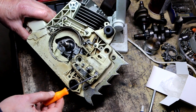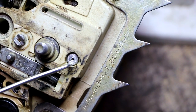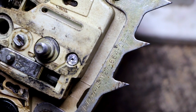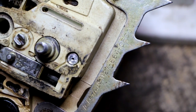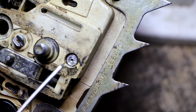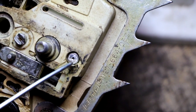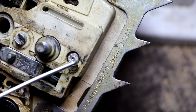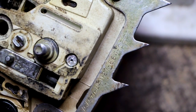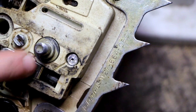While we're on the subject, I also want to point out this little metal device right here — this is a vent, a little venting valve to keep atmospheric pressure correct inside the oil tank. So if it heats up in the sun or whatever, it doesn't cause pressure to build up to the point where it pushes oil out somewhere it's not supposed to be. To replace it, you push it inward so it falls inside the tank, then drive the new one in from this side.